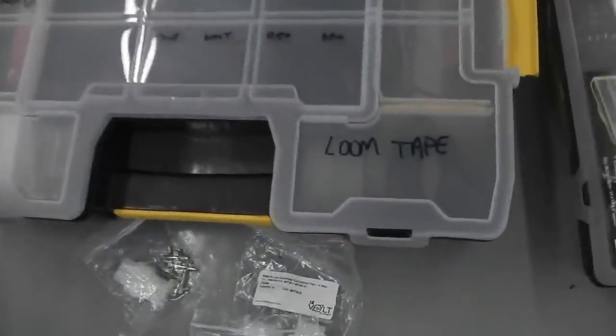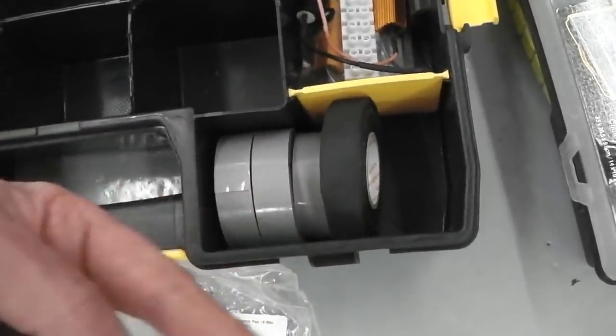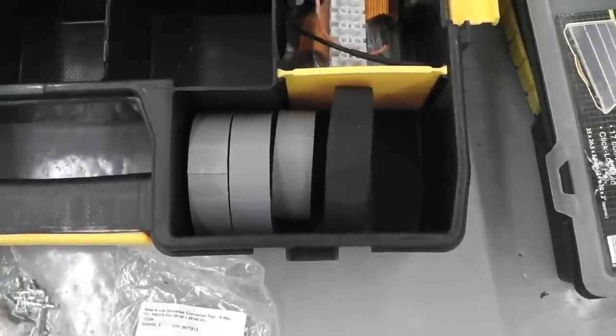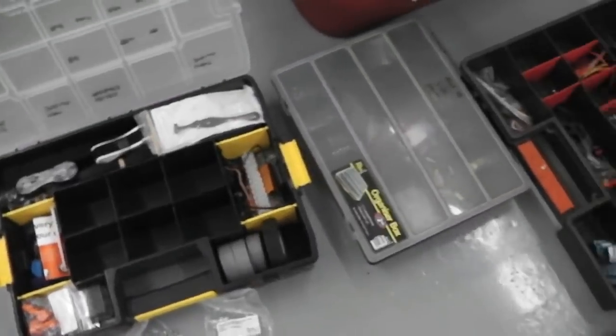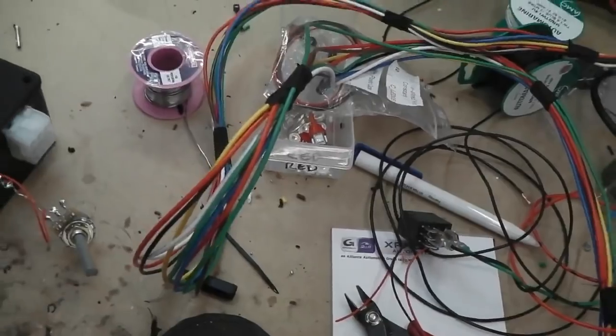We've got as close as you can get to Ford with the grey. It's non-adhesive, so you have to start it off with a little bit of harness tape and then wrap it and finalise with some harness tape, or you can use a glue to finish off as well. Not quite sure how the factory did it. I think they somehow glued the end, probably with a two-part contact adhesive, it looked like, when I've taken looms apart before. Leave this to me. I shall now wrap the loom.